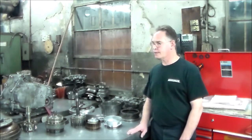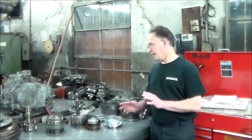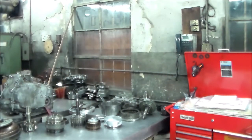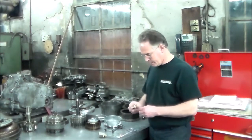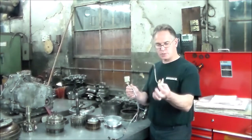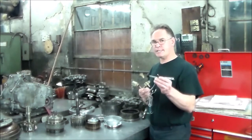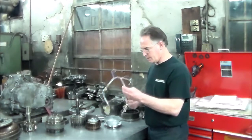All right, so let me get a little closer, and then we can start with what the problem was. I'll show you the problem and what's bad, and then we can just start going through the transmission. And also this AB60, which I also want to show you. I just have to grab this stuff so I don't forget. This is the only 6-speed in the family of the 6-speeds that actually has 2 harnesses right next to each other. And this small harness is just for the SL2 solenoid. I'm honestly not sure why they did that. This also has 2 temp sensors, kind of like the A750. I have the function of those sensors written down, and then the rest, of course, are the solenoids.